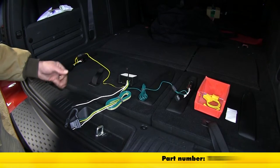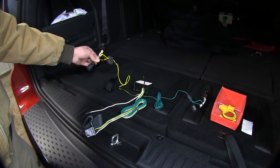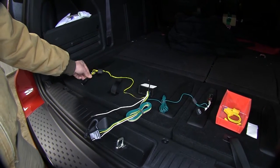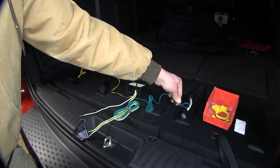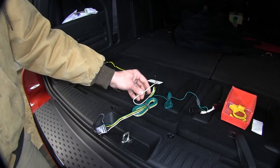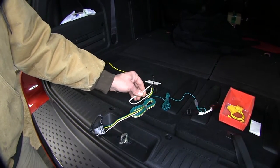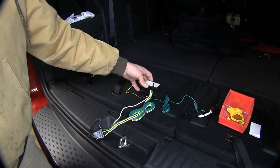This is what the harness is going to look like when we receive it. We've got the brown and yellow T side — this goes to the driver's side of the vehicle. We've got our green T side, this goes behind our passenger side tail light. We're going to have the white ground wire for our module, which gets attached to any of the body panels behind the tail light housing.